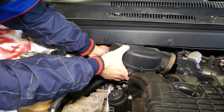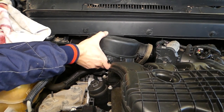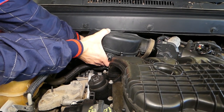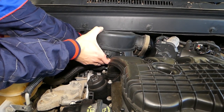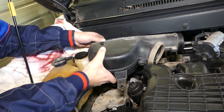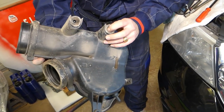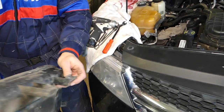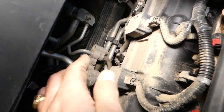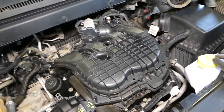This thing is proving difficult. It may not come out without removing the upper intake manifold, because if you push towards the back it can come out like that. There are two bushings on the back that we need to release. On the back side, here is one of them and here is the other one right there. So next you can remove the whole upper intake together with the throttle body.